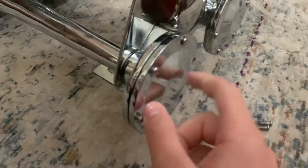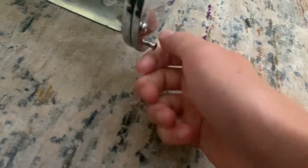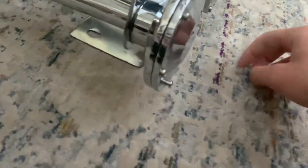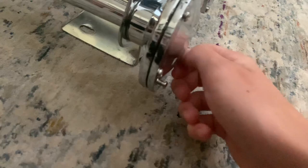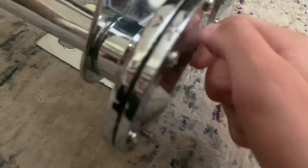What I did here was show you the inside of the power chamber, took the diaphragm out, and flipped it. The diaphragm is in fine condition. When you reassemble the horn, it might sound a bit wheezy or weird at first, but once it starts to break in again on the clean side, it should sound just fine. If it doesn't, you'll probably need a new diaphragm. Do anything you can to clean it first, as places like Four State Trucks charge way too much for what is essentially a thin metal disc. You can probably get an air chime K-bell diaphragm for even cheaper.